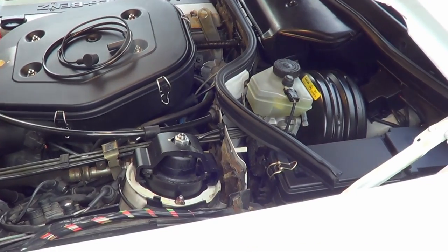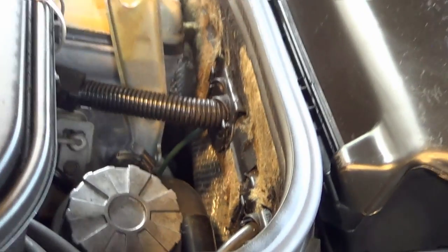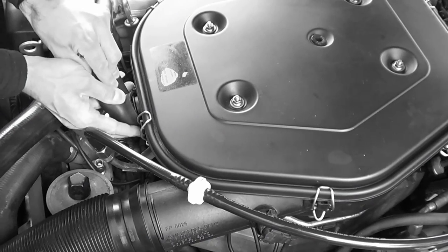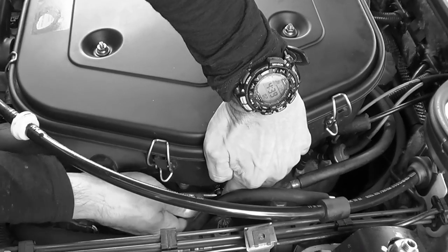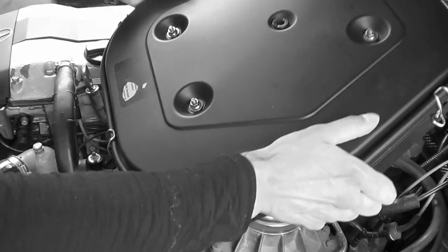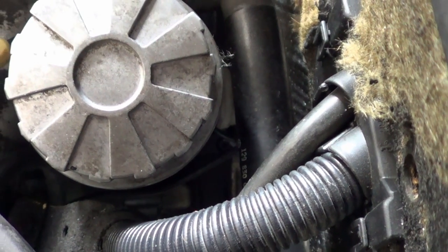Let's replace mine. On my car, it's in a tough position, but possible to take out. On other R129s like the 500SL, you actually have more space to get to it. On others like the 124, the space is a lot tighter than what you see here. Let me take the air filter out for a better view. If you follow this nylon tubing I have here, it's just meant to be a guide. There's the five millimeter Allen key that we need — a little hard to picture here — but that is where it's kind of connected.